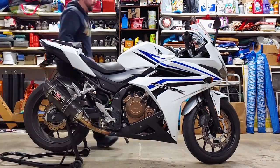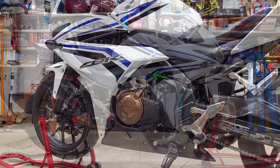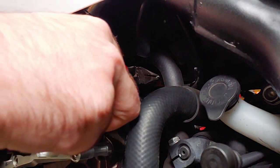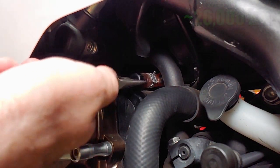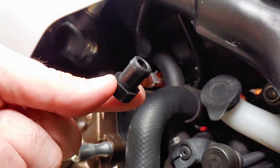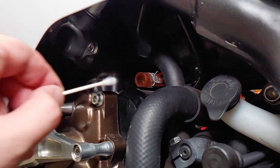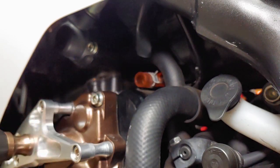I'll start by putting the bike on stands to keep it level for checking fluids. The crankcase breather hose is on the upper left side of the engine. First, slide the hose clamp back, then pull the cap off and drain any fluid or debris you find inside. After 16,000 miles I haven't found anything inside yet, but it's easy enough to check. You'll need to lift up the fuel tank to inspect the breather hose for damage, deterioration, and loose connections — I've already made a separate video on how to do that, so check for a link in the description.